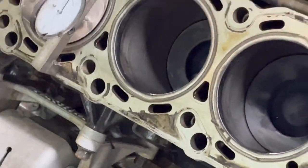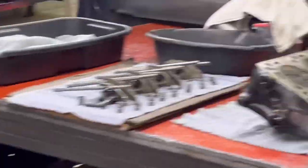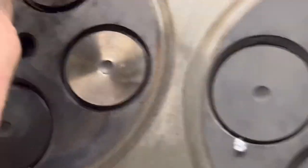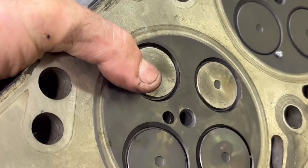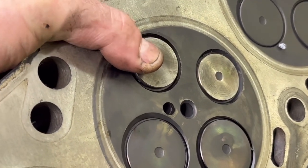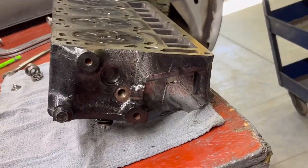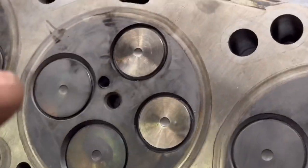So that's the spring. That's the spring broke, because nothing else barely even hit. It was probably just bouncing off of it as the head was going up. So we probably ought to go ahead and replace both these valves, put 2 new valves in it, just because they had no tension on it, right? They were just sitting there, kind of hovering, because the engine was running. It was pretty violent, there were explosions going on. And the piston, if it did touch it, it would just touch it straight on. Now, these valves are not canted. They're level, square in the head, the piston is square, the deck surface where it touches is square. So all it does is put it under extreme stress and push it straight. I don't know, what do you think of that little area right there?